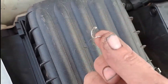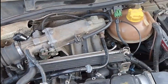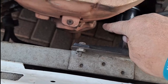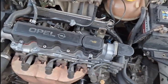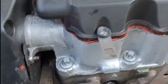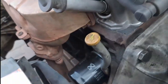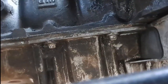Good news guys — I got the clip, it was lying on the ground, I'm just going to put that back. The engine is complete, everything is together. We've got oil levels right, water levels right, we took it for a spin, put in some petrol, came back now. The only issue I have is exhaust fumes going past that exhaust pipe, but we'll get a ring for that. Tomorrow I'll be going to work with it — for the next two days I'll be driving about 120 km and we'll see again if there's any leaking. The initial leak is not there anymore — the initial problem is stopped. There's no leaking from between the cam box and the head, no water coming from the head gasket, and our sump is also dry with no oil coming from the gasket.